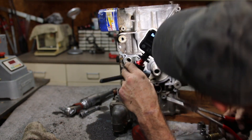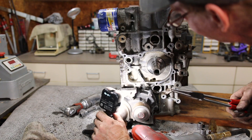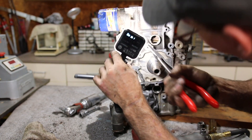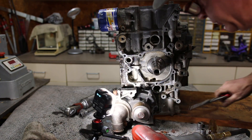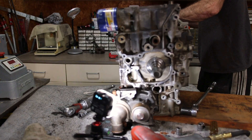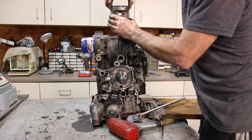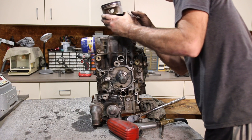With that cover off, we need to get the piston pin out. You can see the little clip through the hole, so we can just grab the clip. Got the clip — that was a lot easier than I thought. Don't lose anything. Then we can push the piston from the other side. I'm going to leave all the rings so I can see the position and measure them later.